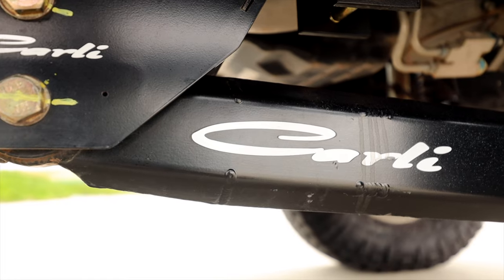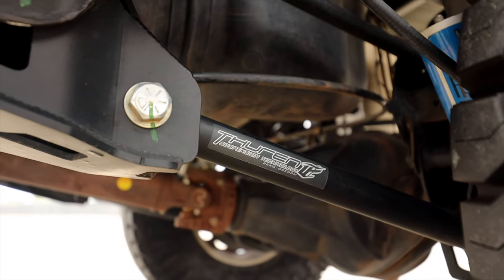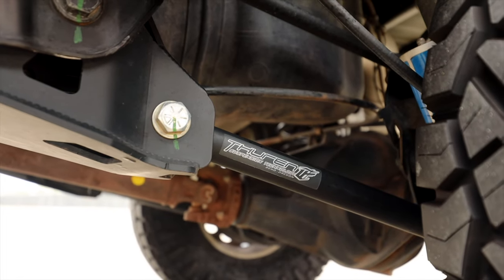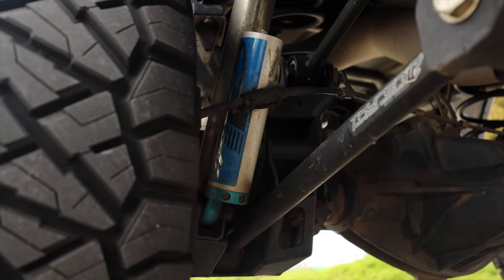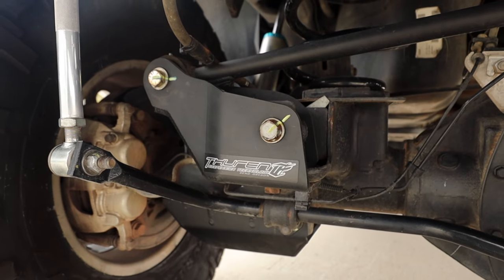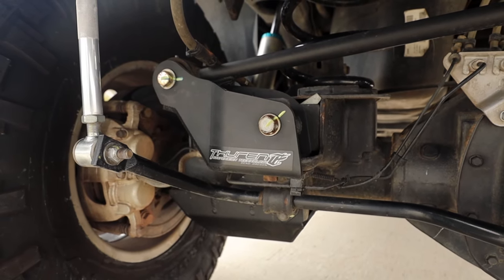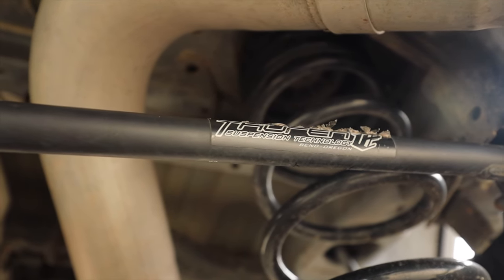I always love looking up through the side of the truck at those radius arms. In the rear I have the prototype Third Base kit — a rear arm kit that fixes the OE geometry and stops axle hop, which it most definitely does. In sandy, silty, and snowy conditions if you've ever mashed the gas in your 2500 you've probably noticed axle hopping. This kit completely fixes that — even driving off red lights now there is no more axle hop. It's super nice to have a truck that feels planted to the ground. I also added the Thurin rear track bar to tie everything together, which helped eliminate the wag — that side-to-side rocking motion. This truck feels planted and almost feels like a leaf-sprung truck now.